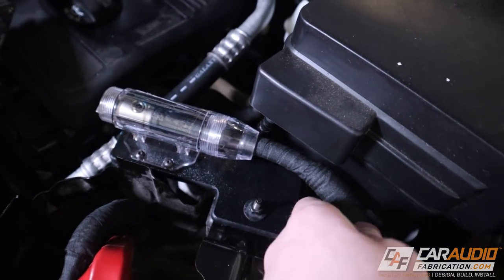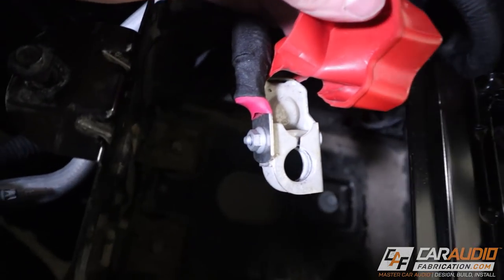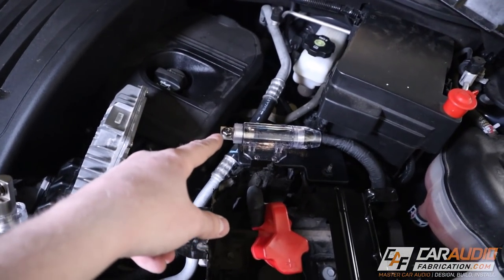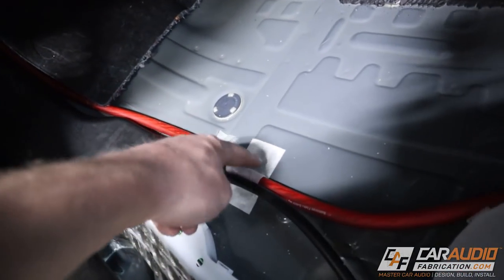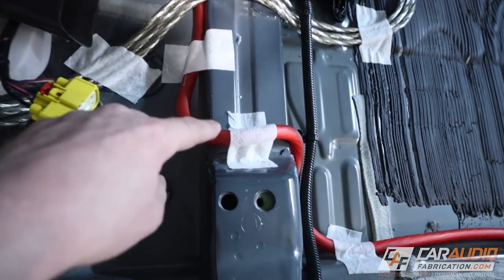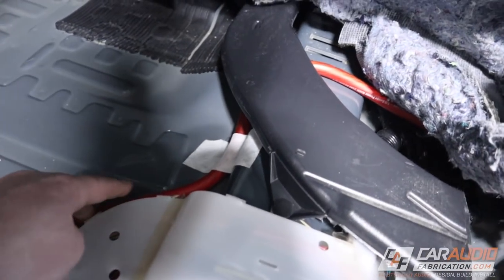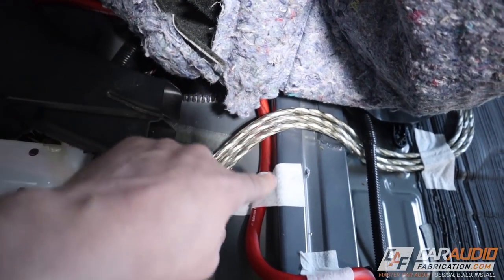Now we are mounted up with the fuse holder. I've got my wire ran through here and I've also got the wire connected to the positive battery terminal. Once we are ready, I can attach the fuse, insert everything, and we are good to go — but we're not going to attach the fuse quite yet because we're still working inside the car. Now we're making some major progress. I've got the power wire ran here, secured in a couple of different spots along the way with these special patches. It's usually not an issue running close to speaker wires, but in general the best practice is you do want to keep some distance between your speaker wires, and if you do have to come close, you want to try to do so at an angle.